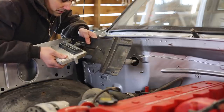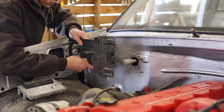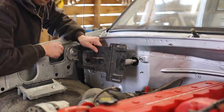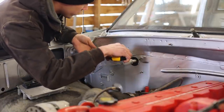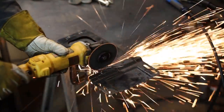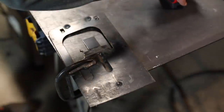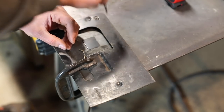It is time to mount the PCM. The PCM mounts to this bracket and I'm going to adapt this bracket — which is meant for the Dodge — to mount here using the two bolt holes for the coolant reservoir. So I've got to drill a couple of holes in this and then cut this part off. These look like they're about seven inches on center. Seven inches is about that long, and I can place this fairly arbitrarily because I have a lot of wiggle room. The first hole will go there.